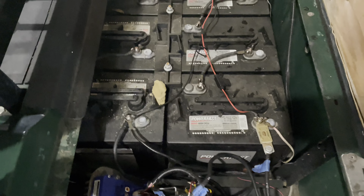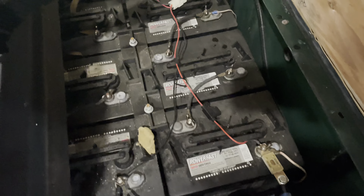You just put an eyelet on it and hook it up right to your fuse block. And the last item we're going to be installing is the charge receptacle replacement. We're going to take out his old receptacle — it has the EZ-GO plug in it — and now he will have a 110 male plug and we'll plug the charger in here.